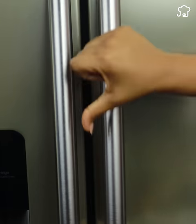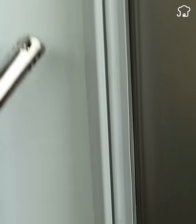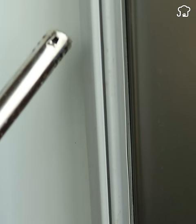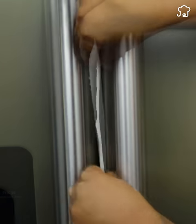This can also cause your food to not be preserved or to be damaged. To solve that, take a hot air blower and heat the entire rubber band of the refrigerator door. This will help to renew the rubber seal so your door will close completely. When doing the test again with the paper, you will notice that the paper is well attached to the door until it breaks.